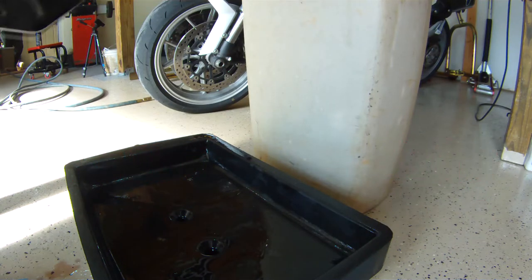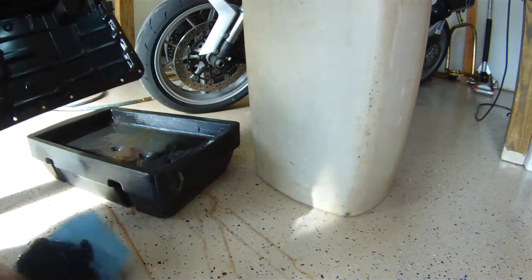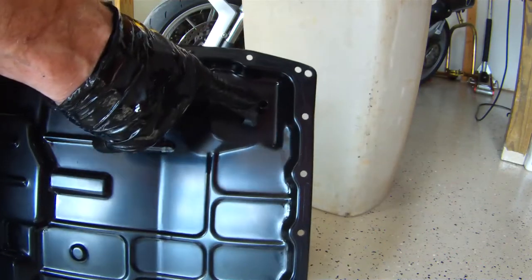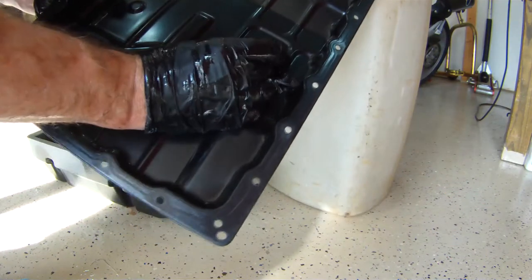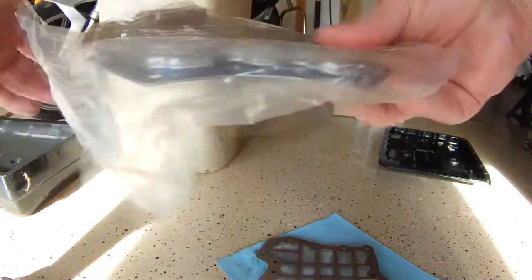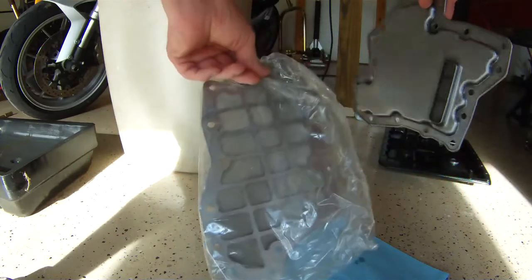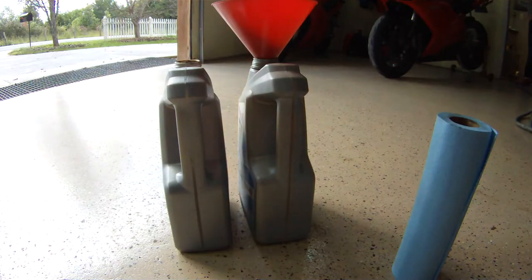I really like to scrub the pan and get it clean inside and out — I like to have the inside and the outside bottom of the pan clean. There is your fill level plug that we'll use when we fill and drain the transmission. Here are the magnets going back on, and now the pan is ready to be put back on the car. Here is a brand new 350Z filter, and in my right hand is your 370Z filter. You can see they're different but the same material — the 370Z is just a little bit larger.